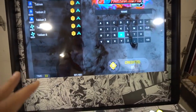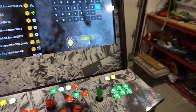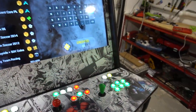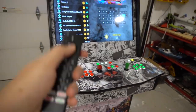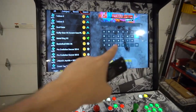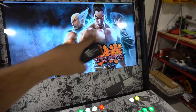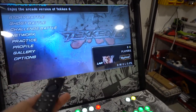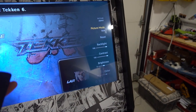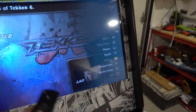The big thing to note: when I launched the game and held down the button, you didn't see button B to exit. This is the big thing I mentioned in my previous videos when it comes to the Insignia 32-inch TV in this cabinet. It's two different things and I don't know why, but it is what it is. I'm a big fan of when you plug the system in, the TV boots and the system boots automatically. This TV right now is set to store mode. When it's set to store mode, I basically cannot change the resolution or the stretch settings. If I go to display, I can't pick display — this display right now is stretched and nothing I can really do about it because it's in store mode.